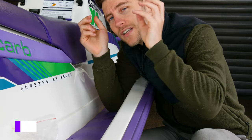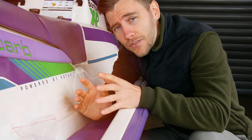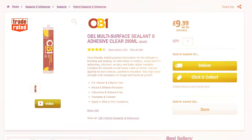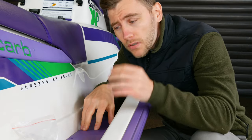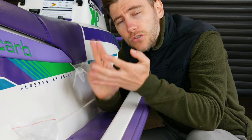So we are back. I started to look into the best adhesive to use on these bumpy footwells. In all honesty, there are tons of adhesives and you need to do your research because one of the key things I find is if you use the wrong one, it could have a detrimental effect. Things like, is it solvent free? Because if it has solvents in it, it could potentially attack the back of the foot mats and even worse, potentially damage the gel coat and the fiberglass. So we don't want any of that. Solvent free is key.